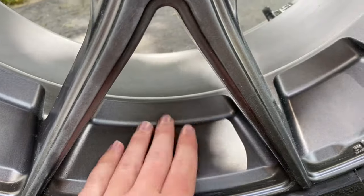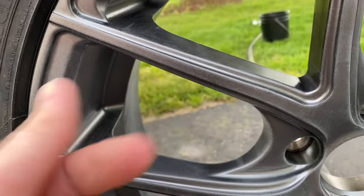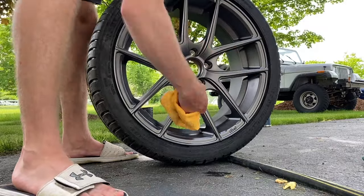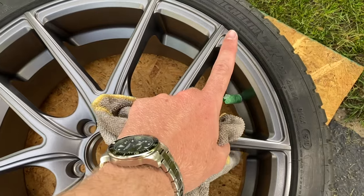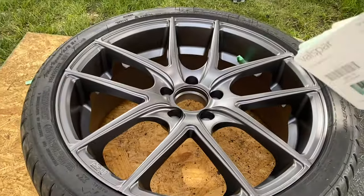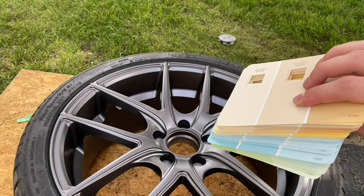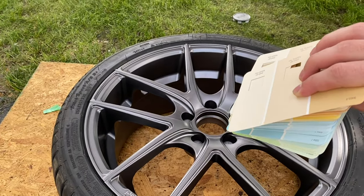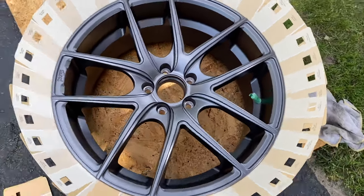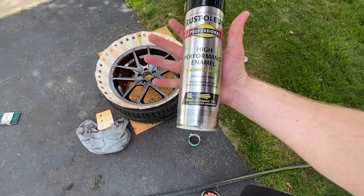That actually took so long for the entire wheel, but it's all scuffed up now. It just has this powdery stuff that came off of the Brillo pad, so I'm going to wet it down and dry it off with a microfiber towel to make sure the paint is ready to go. Make sure to mask off your valve stems because you don't want paint on them — that's pretty much self-explanatory. If you don't recognize what these are, these are the paint color sample cards you can get for free at Home Depot, Lowe's, etc. These are what we're going to use for masking.